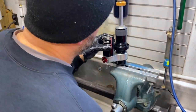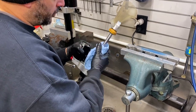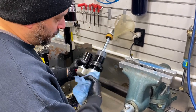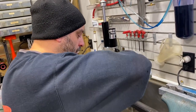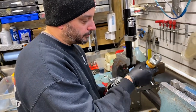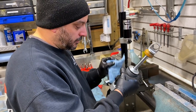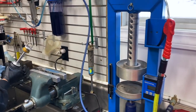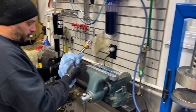We have it charged and wiped down, everything so far looks good. Another good thing is to clean it with some Simple Green or soap and water, get it nice, then just let it sit out — if you have time, half an hour to an hour on a clean piece of paper or towel — and you'll know if you have any issues. A lot of times if I even question that there's an issue, I'll stick it in the shock dyno, let it get up to 150 to 200 degrees, let it cycle, and verify that there's no issue.